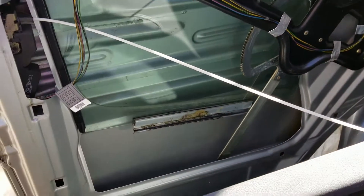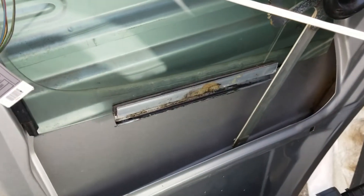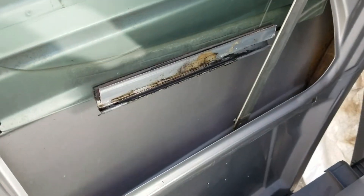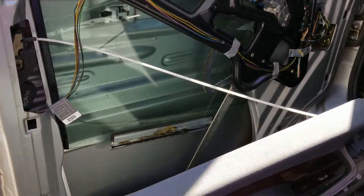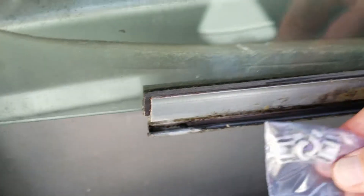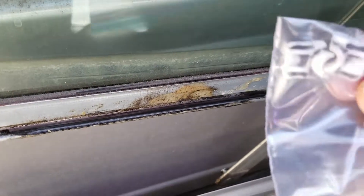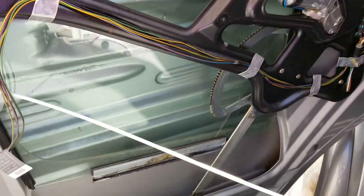I'm going to try to fix it using JB plastic weld and a small plastic tie strap. If I can get this done, I don't have to replace the entire window regulator or wait for parts. This little slider is the key piece that slides back and forth attached to the arm as the window goes up and down — a little plastic piece that can cost you a thousand dollars. There's no way of replacing it; you have to buy the whole arm unless you try to fix it like I'm doing.